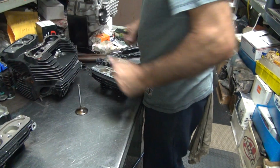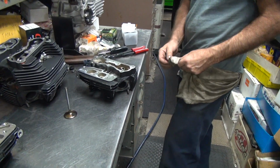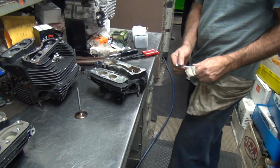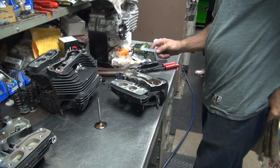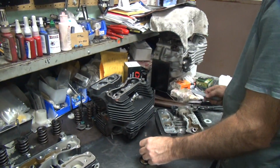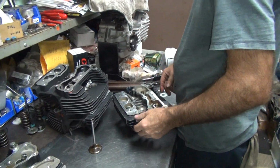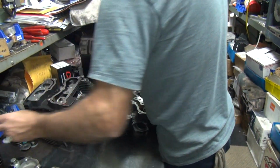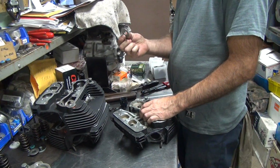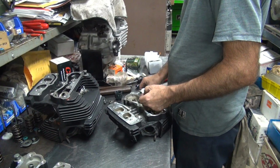Yeah. I just have to come down to a lot less than we got. And you can do that, machine that out of there? Yeah. So I gotta get down to under 680. 675, 680 is the sweet spot. That's with that one valve. So if we do the other ones, it might be a little different. Because right now we got 30 thou of shim. If we put 50 thou of shim under there, that's going to raise things up. Things change a little bit.